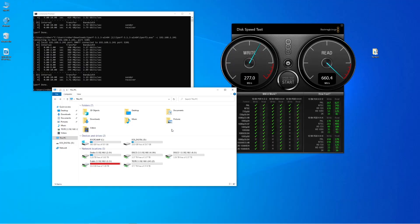Here it is — 730 MB/s is the maximum I've got so far using the Mac Mini with Windows. On Windows I didn't record the screen well, but we could reach 600-something and then the maximum of 730. iPerf is giving me lower results than this, and that's not fair to any of these four components, because iPerf only measures the network — and I was able to transfer real actual files at a much superior speed than what iPerf tells me.